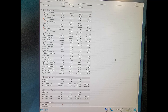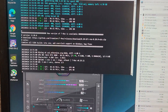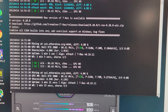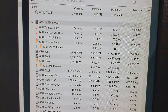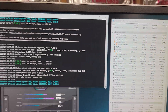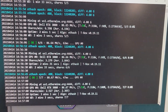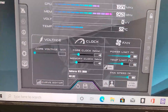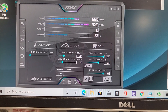Out of the box, here's a few screenshots. You'll see we're around 106 degrees on the memory temp. By default we're only getting around 86 megahash per second with the default clock and memory settings. There's a screenshot — 106 degrees. We're smoking pretty good out of the box. This is clearly not going to work for intensive gaming or mining on the long haul. A couple more snaps of the temps — 50 degrees base, give or take.